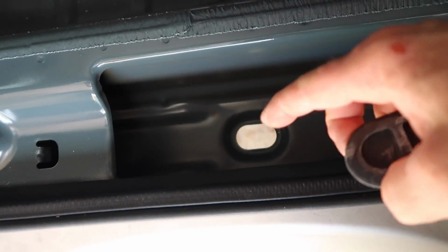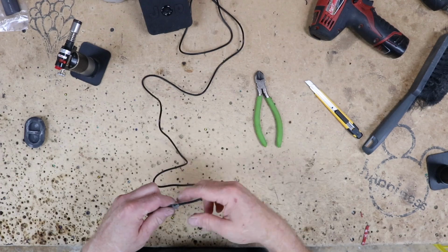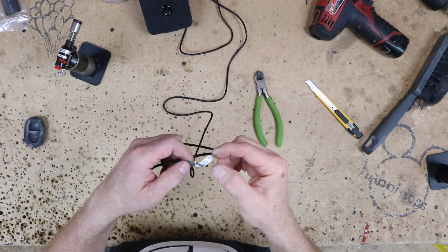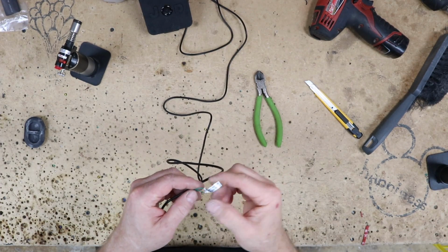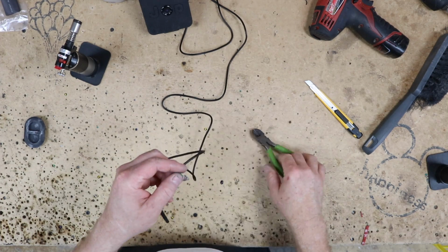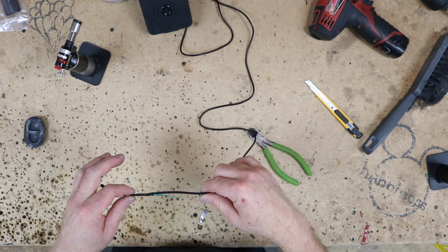This is what we want to get right here. This is what we're going to use to come up through, so we're going to cut a hole out of here. So on this camera, they have this cool little silver flag on this little green wire that says cut this loop to deactivate the parking guidelines. Now the Alpine radio has great guidelines, so we're actually going to go ahead and cut this. We'll go ahead and cover this in some shrink wrap.